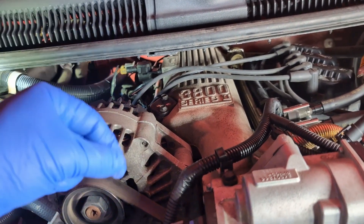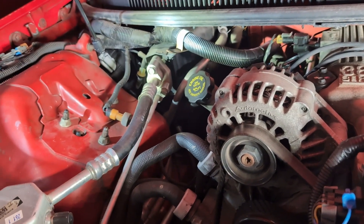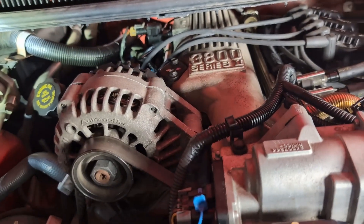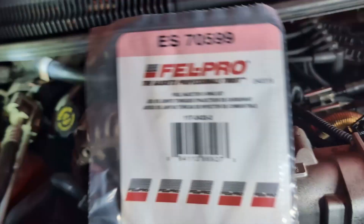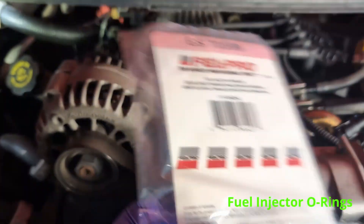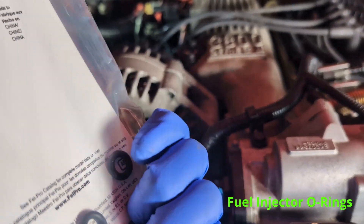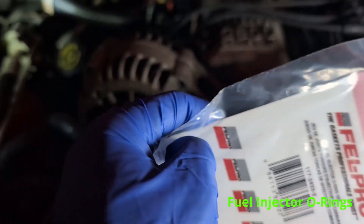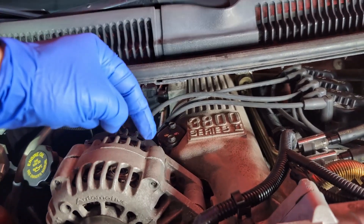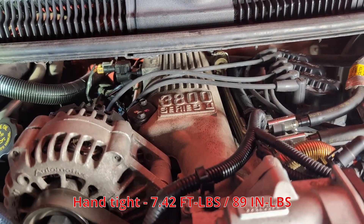Once you've got the new regulator in, you're going in reverse — bring the fuel rail back in and fit all six injectors into their holes. Before you do that, maybe use some carburetor cleaner to clean the injectors. Check all the o-rings; I didn't have to replace any of mine but I did buy some just in case — they're quite substantial o-rings. Oil the o-rings too so you get a good seal. Once the injectors are lined back up, stick the four bolts in — two per side — and tighten them down; that'll push the injectors in and seat them exactly where they should be.